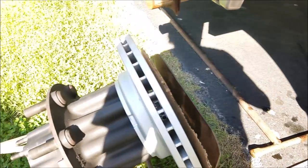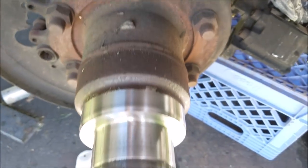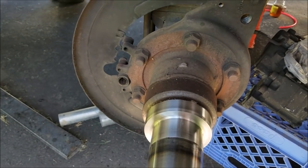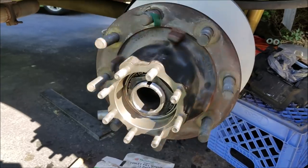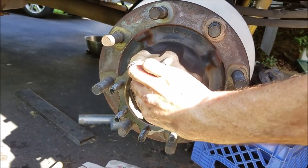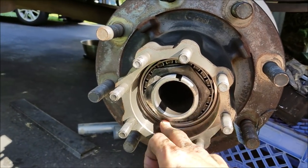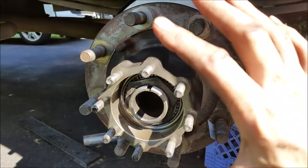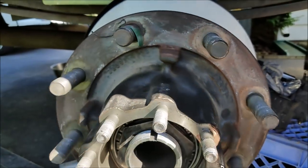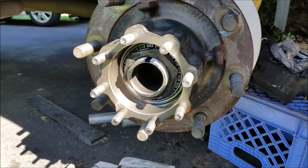Moment of truth — I'm about ready to put this big old heavy monster on this rear axle stub. I cleaned this up really good with some Scotch-Brite. I've got the wife here, so as soon as I get it in there she's going to slide the outer bearing on. Well, we have success — it went on fairly easy. I thought it would give me more trouble. Once I got it on there, I just took the palm of my hands and pressed on it, then was able to slowly tighten that nut up. You've got to be careful that those threads don't come in contact with that new race. I had the wife watching as I got it in position because I couldn't see as I was getting it in place — that's going to work just dandy.